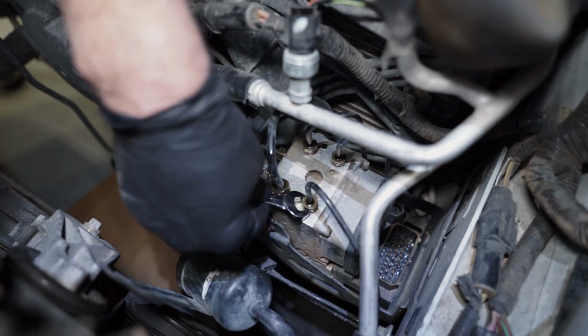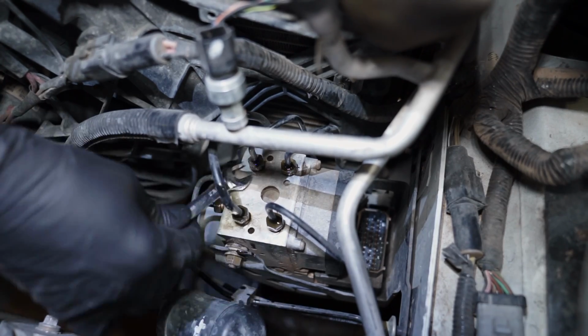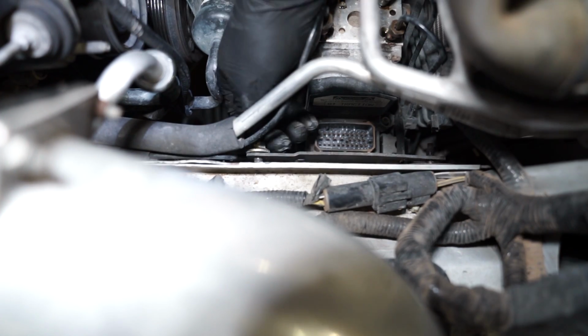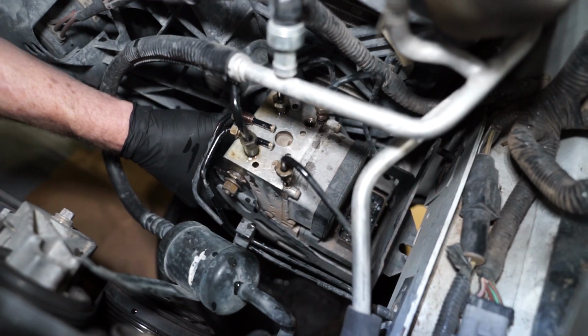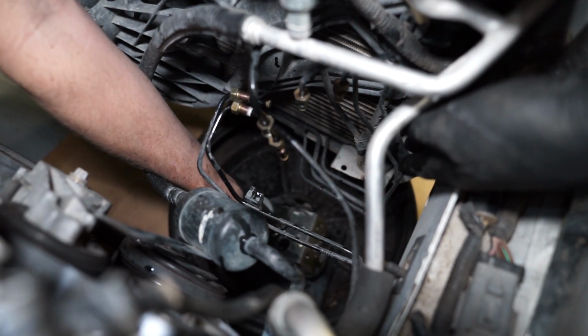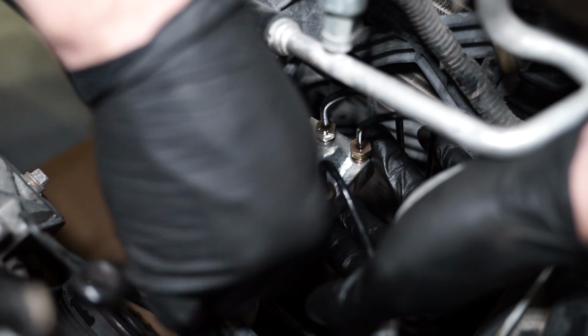Use an open end wrench to loosen each fitting the rest of the way. Remove the lines from the ports. Remove the retaining nut from the frame rail. Pass the bracket over the stud, and then feed the module out of the car from the bottom. Position the delete block into place.